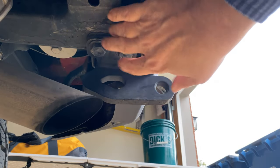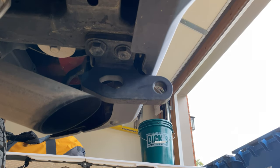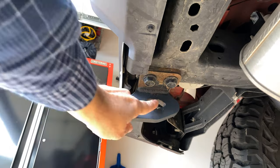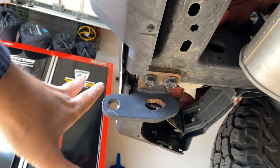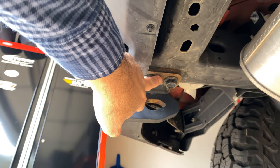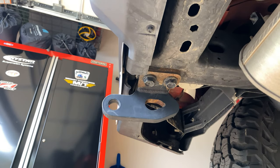On one side I don't see really any flaking or anything — I've not had to touch this one up. I did have to sand the pinhole a little bit, but other than that, this side's good. On the other side, in those 10 months there is some corrosion and some flaking of the powder coating coming off. Initially I had a red set, and when I went to torque them down to 94 foot-pounds, the powder coating on those cracked and lifted up. To their credit, they sent me a new set. I did spray paint these with a clear enamel to slow the corrosion down, but there are new spots appearing, so I'm probably going to break out some black enamel after I flake off all the powder coating, because if you don't, it will just hold moisture under there.